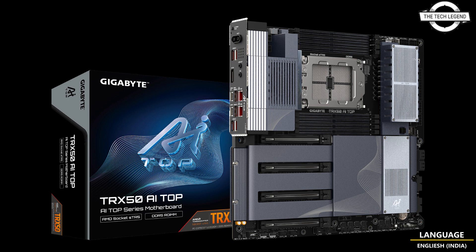As this is the USB 4 model, USB is of course also part of the package, but only one of the two USB ports supports DisplayPort alternate mode, due to there being only one DP input. The board also has an internal USB 3.2 Gen 2x2 20 Gbps header for a case-mounted USB Type-C port, a further 6 rear 5 Gbps USB Type-A ports, plus a pair of internal headers for a further 4 5 Gbps USB Type-A ports.